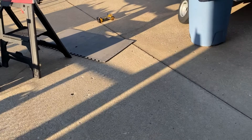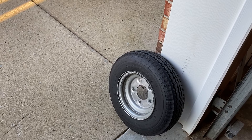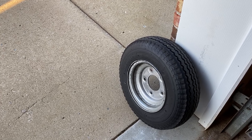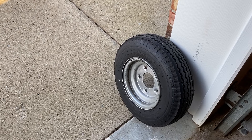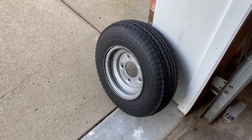Let me start out with talking about the tires. They're a little bitty, and unless you can find somebody who's got a magic machine that can do it, they're hard to balance. Some people say they don't need to be balanced, but I tend to run down the interstate at 70-plus miles an hour. Them little babies are spinning their hearts out. So I decided to buy some tire balancing beads to stick in there — they've got a chart for the correct ounce amount for that particular size tire.